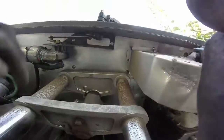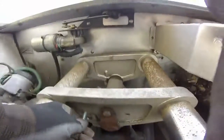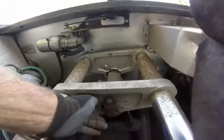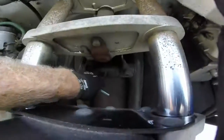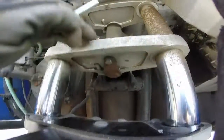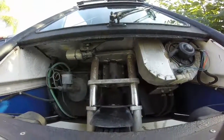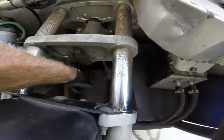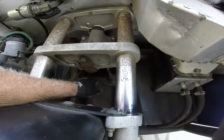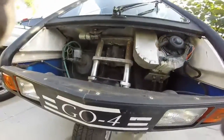The holes we're going to use are the aluminum holes on the fork itself. These things are already pre-drilled, so that's what we're going to be using. The U-bolt's going to go back here, mending plates here, and that's pretty much how it's going to work. So I'll show you what the first step is. First thing we're going to do is put the U-bolt back here, so we have a way to connect it back here to the body.